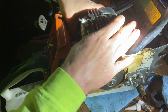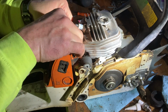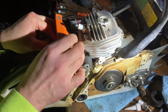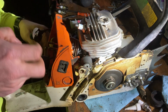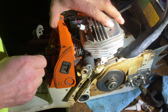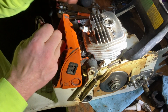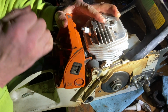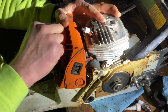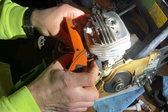I don't know if anybody out there has ever had to rope a windshield into an older vehicle, like a 70s model, like the old Ford pickups, things like that. That is basically how you do that. As you just pull the rope out, it pulls the lip of the intake through. Right there it is.